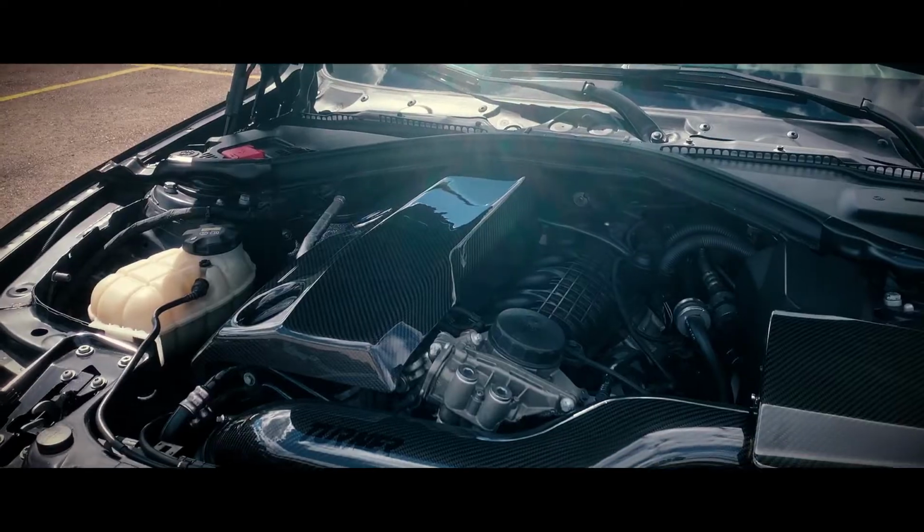So this car has a twin power turbo, and what that means in BMW marketing translation is it's a single turbo application with a twin scroll design. I've replaced the stock unit with a larger unit from Pure Turbos, and I think my ceiling is somewhere around 600 horsepower now, but I'm well below that because I haven't done any of the custom tuning to get to that extra additional horsepower.